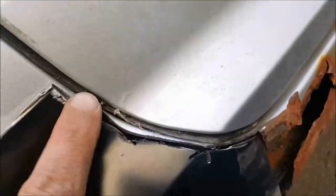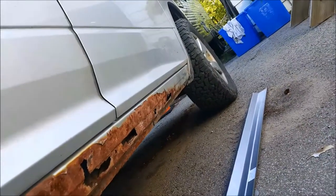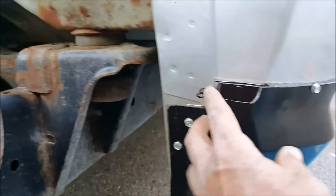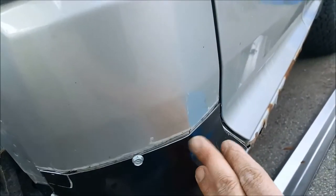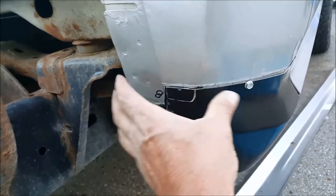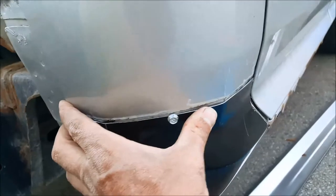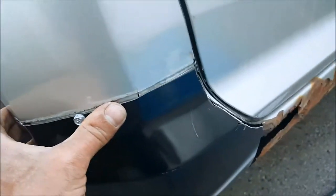I didn't get into the door area here - I'm going to be just outside of it, and I hope that's what happens all the way down the rotted out rocker when I put that in. I've got everything all anchored in with sheet metal screws temporarily. This isn't going to line up here - in order for these body lines to line up, when I go to weld this in I'm going to start here and work my way around, close up this little gap as I come around that corner just a little bit to push it over just a tiny bit.